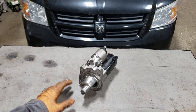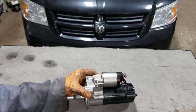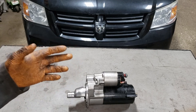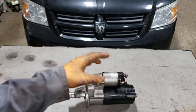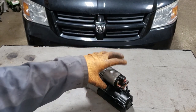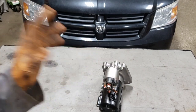If you don't hear any clicks at all, most times the culprit is going to be this guy here. Now that doesn't necessarily mean that the starter is bad, but it does mean potentially that you may have a broken wire. Sometimes I have seen the solenoid wire, which is a thin little wire, corrode out, so you've got to check that thing for signal and I'll show you how to do that with the power probe.